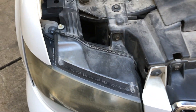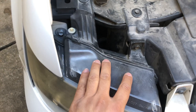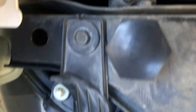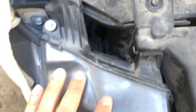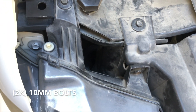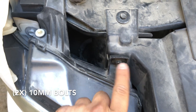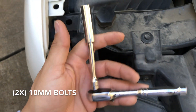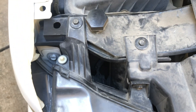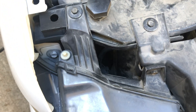Open your hood. Now that you've opened your hood, I'm going to do the left side — the passenger side — but it's the same for the driver's side. As you can see, the light bulb is in there, but you can't change it because there's not a lot of space. So I'm going to remove the headlight. To start off, we'll use a size 10 — there are two bolts, this one and this one. Go ahead and remove those two size-10 bolts. Once you remove them, we can bring out the headlight and reach for the light bulb.